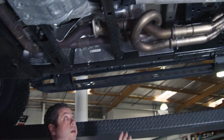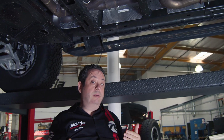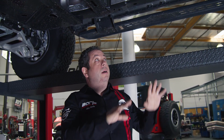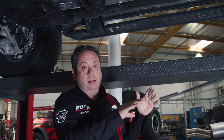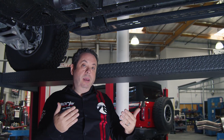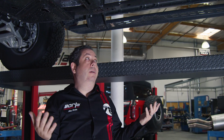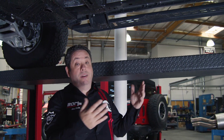One of the first things we did was get rid of the trombone loop and just put straight pipes here to see what it sounds like, and we discovered right away that this trombone loop adds a lot. So the next thing we did was we started playing around with different lengths. And what we discovered was actually that equal length didn't really matter that much. It doesn't have to be exactly equal length. We thought that maybe if we tried some asymmetrical designs, we'd get a different note, and it really didn't change very much, if anything at all.